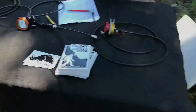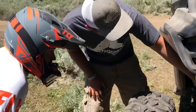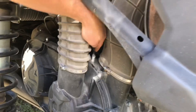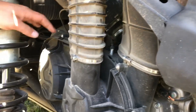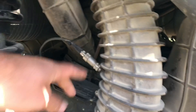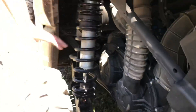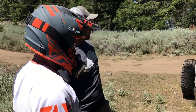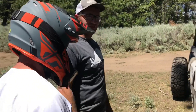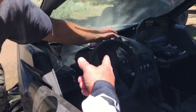So where do you put the sensor on your machine? We can show you on this Can-Am over here. You drill a half-inch hole in the clutch cover directly over the belt. On these Can-Am X3s, you look kind of in between those two ducts — you can see it right there. It still keeps it all nice and waterproof, and we have it set up with a nice disconnect. On the Polaris, a lot of people mount them in the covers, so if you ever need to pull your clutch cover, you can disconnect the sensor without fighting the cabling. Then there's a power and ground wire that you hook to a key-on source.